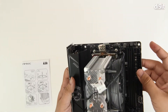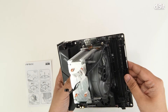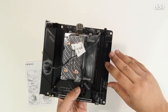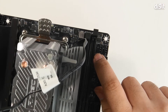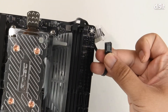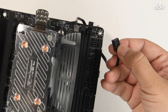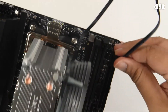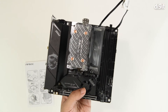Once that part is over, you need to connect the cooling fan of your CPU cooler onto the motherboard. Look for a 4-pin or 3-pin fan header that states CPU fan. This is the MSI MPG B550i Gaming Edge Wi-Fi motherboard, and this 4-pin header is the CPU fan header. Right next to it is the water pump header, in case you're connecting an AIO. The fan connector has two plastic tabs on the back which help you align it with the fan header on the motherboard. In this case it's the bottom 3 pins that will be connected. Once they're aligned, push down and you've successfully connected the fan.